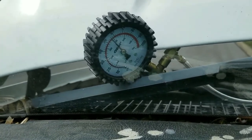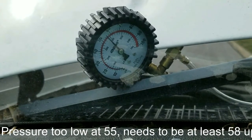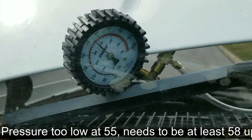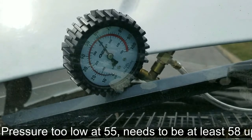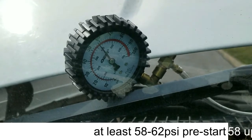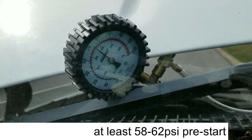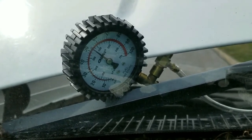All right, so I did want to show you. Okay, the pressure's up there because I already started. I'm going to go ahead and, fuel pump kicked on. See that little extra jump on there? And there was a little buzz before that. This truck's going to start right up right now. So that's the big mystery, that extra little sound that I'm hearing, but it certainly added more fuel pressure on that line. I'm glad I caught it, because that was the big problem, what's going on.